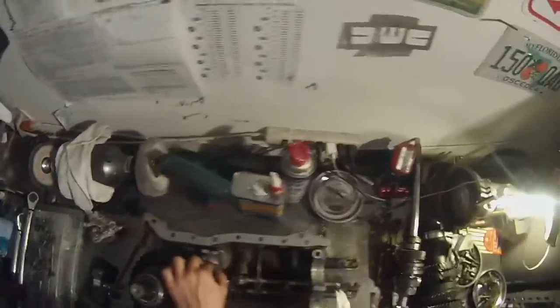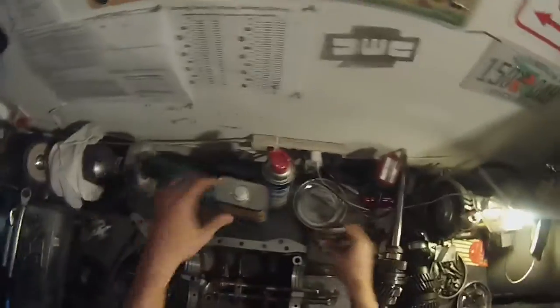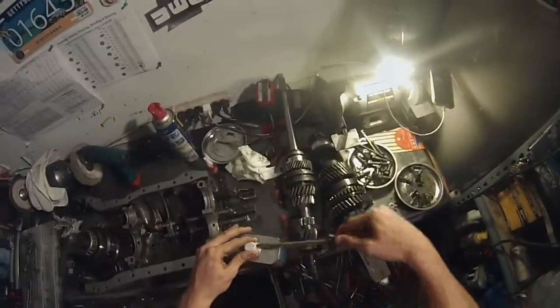In order to do that, you have to take both shafts out. Before you get to this point, you do want to clean the case out — make sure there's no debris or anything in there. I used a blow nozzle on the end of an air compressor to do that.